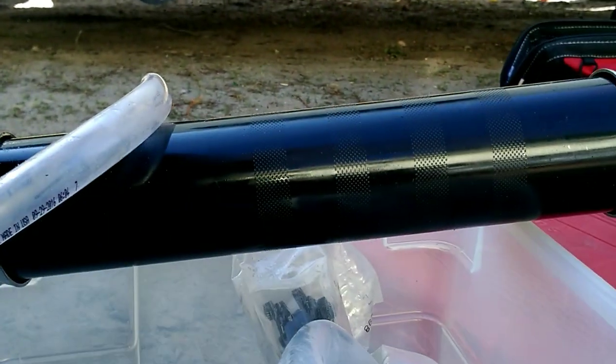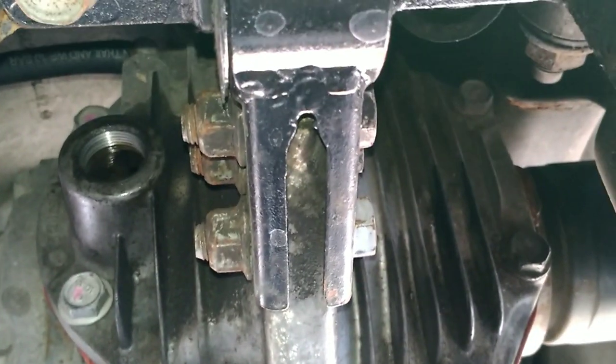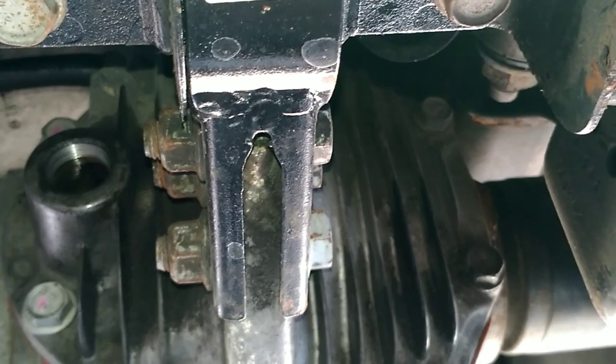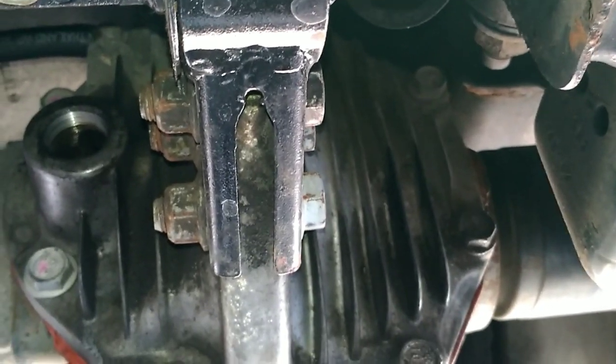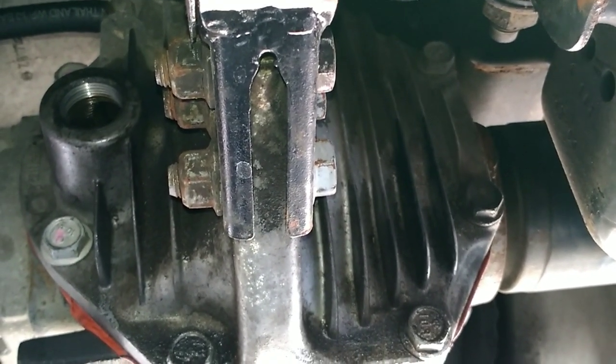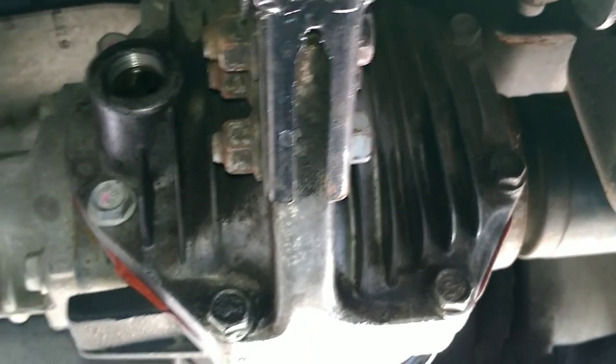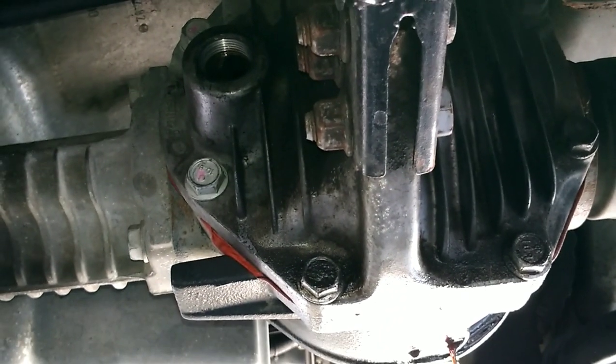Then you just load up the pump. It takes a few shots to get all the fluid in, then squirt it in through the filler hole. You're going to be on ramps to do this more than likely, so you'll end up being a little bit over full. You have to decide whether you want to be over full or not — it might become an issue later on.